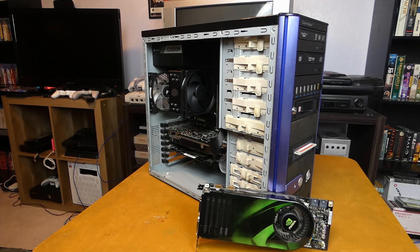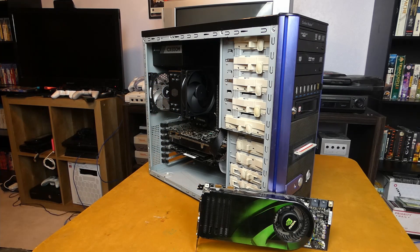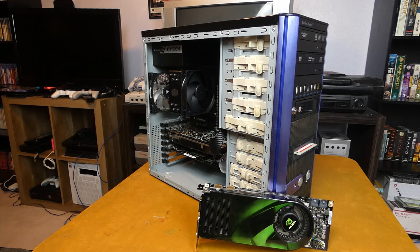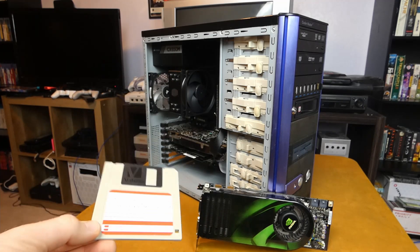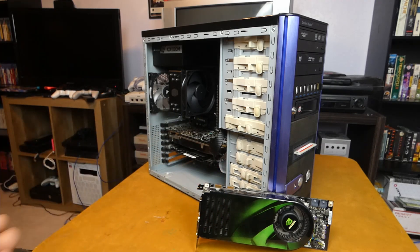That's pretty much it for what's going on with the XP machine for the moment. We upgraded the thermals, we upgraded the performance, and we upgraded the noise level too, because only having one GPU in there does make the system a lot quieter. Plus the fan on the Hyper 212 is a little bit quieter than the Zalman. Finally for once, everything went pretty much how I wanted to, other than not being able to overclock the CPU quite as high as I'd like — but 3.2 gigahertz is nothing to shake a stick at. And one last thing: I finally replaced the temporary zip drive with a floppy drive. There's nothing wrong with the zip drive, but floppies are a lot more useful to me than zip disks. Am I ever practically going to use it? Probably not, but if I need to write a floppy image or something, it's probably more convenient than pulling out an external USB drive.